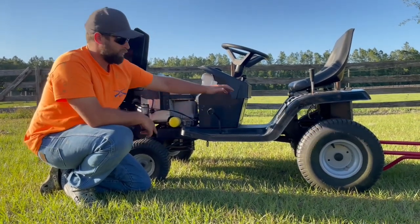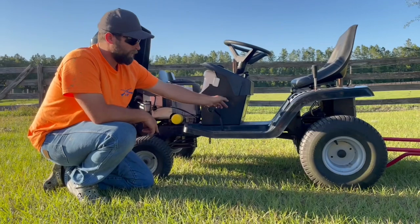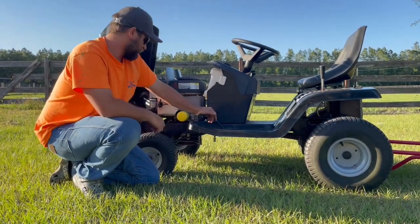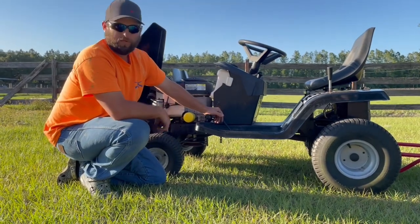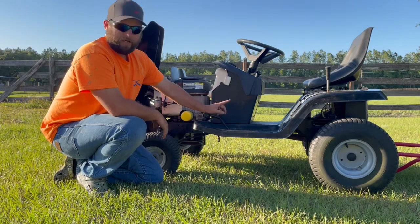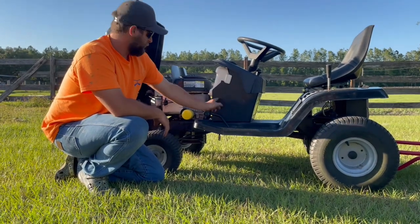The problem is, because the drive belt is shorter, you can no longer lock the brake down. And if you can't lock the brake down, I'm about a half inch short of locking it. And if I tighten it anymore, it'll keep moving even without it in gear. So with the brake not locked down, you can't get off the seat — it'll shut off because the seat safety is active with the brake.